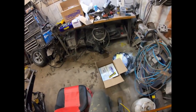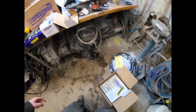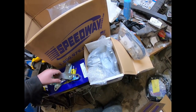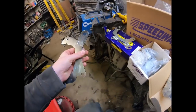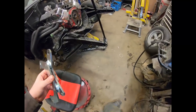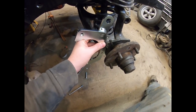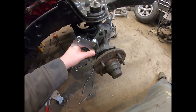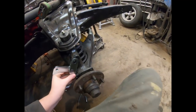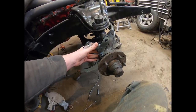So it's a pretty simple kit — it's got discs off like late 60s, early 70s GM, and it just switches over to single piston calipers. The real trick is this little mounting bracket here. Basically I have to take the hub and all that off, but it ends up using existing holes for what would have been the drum. It just ends up bolting in like that, and then that gives you where the calipers go.